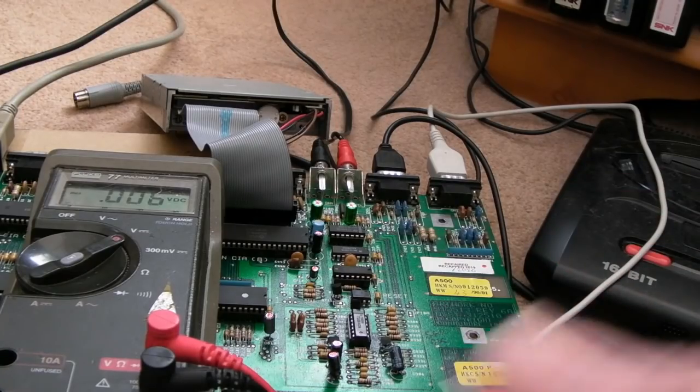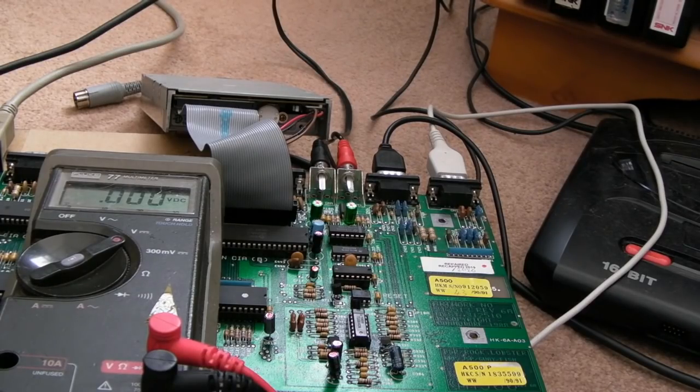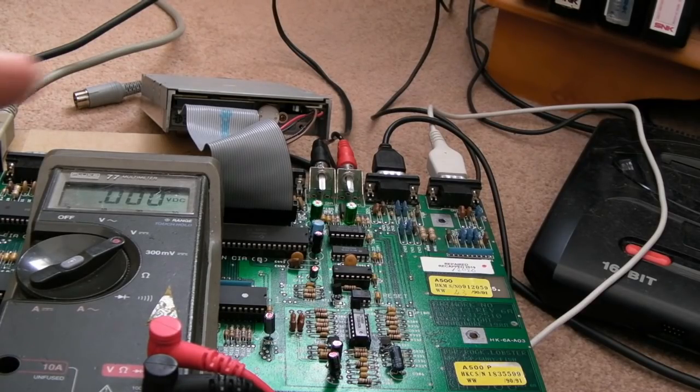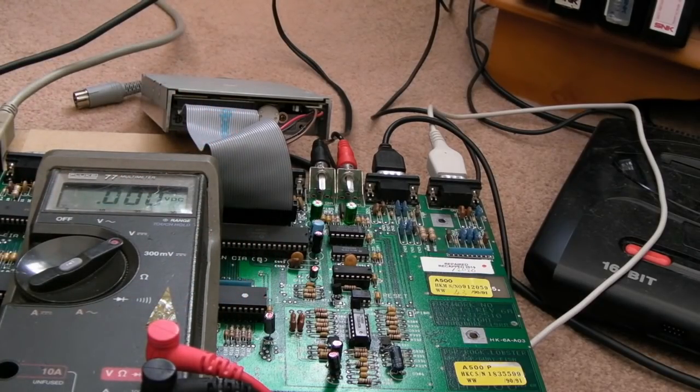I was a bit concerned it might be Paula, because if you watch the A590 video — I'll stick a link to that up there — crazy things were happening with this board actually, and there was a risk I was putting it at risk. Some people said why didn't you measure the voltages when the RAM was on the A590 getting super super hot. I did leave it connected to the meter for a period of time — it didn't do it. That video was filmed over about a month. I said it happened when you connected the floppy drive — but then what would happen, you'd let it all cool down and then it would work all right with the floppy drive. So the floppy drive wasn't really the issue. I think all that was happening there — it's the sequence of events — me testing it for an hour or two, everything's fine, switch it off, connect the floppy drive, switch it on. That sequence of switching one side off while leaving one thing powered — I think was ultimately the issue.